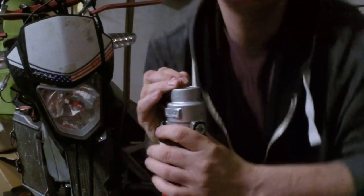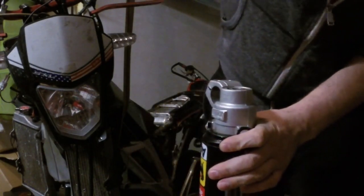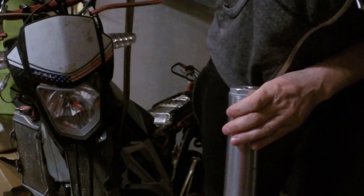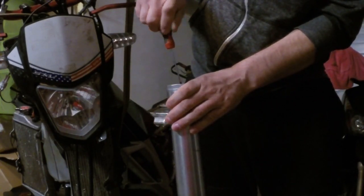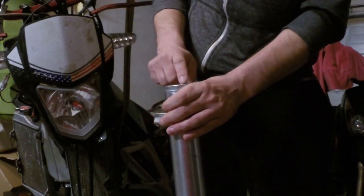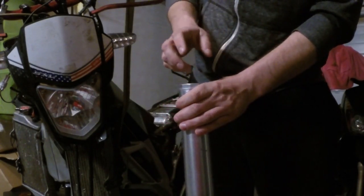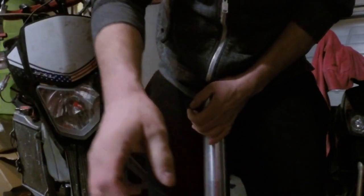Okay, let's see how many we have right now. Right now it's actually turned out fully, so we can see. I will just show you the difference between fully unscrewed and fully turned in. I will just turn out the rebound as well. So now compression underneath and rebound here are fully open. So there should be less resistance than when it's turned in. So let's try here. Okay, you can't really see how deep it's going. But let me do it like that. Wait a second.